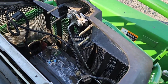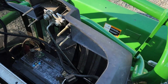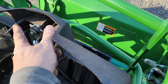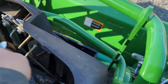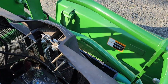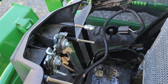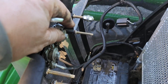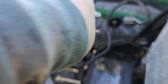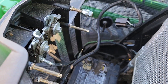These studs have to come out. Someone might say, why not use a grinder to narrow it down? You could, but if you ever have to replace those studs it'll be a pain. Instead, I'm putting two nuts back-to-back — and there it goes, it's coming out. That's the trick to remove these studs.